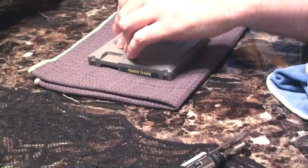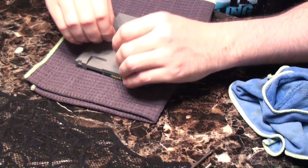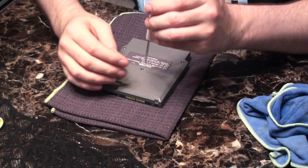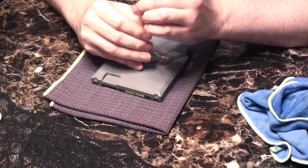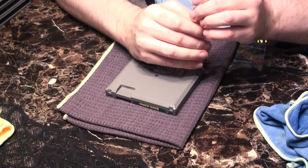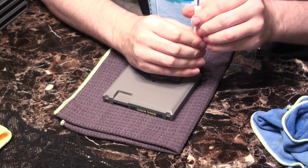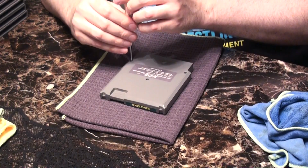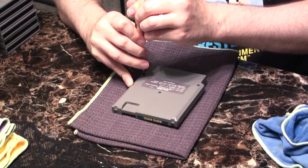And back in the days when Nintendo told us not to blow in our games, you're actually seeing some of the results as to why. Because with the moisture that's in our breath when we talk or try to blow on something, over the years, as the metal picks up that moisture and is exposed to air, it can corrode, and in most cases it will as time goes by. So Nintendo was not necessarily blowing smoke when they told us not to blow in our games, but as kids, we knew it as the method that would work, and so we did it. And fortunately now, all these years later, the damage has not been permanent on any of the games that I've personally owned for that amount of time. But with that being said, probably shouldn't do it if you could avoid it.